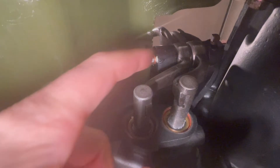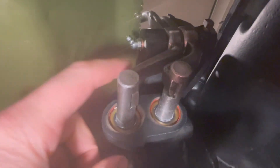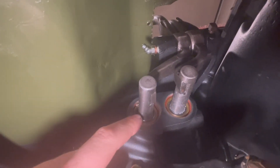This is how the shift levers should be oriented. The one with the longer neck goes to the pin that is further out, and the shorter neck goes to the pin closer to the bell housing. The shifter fits into a little slot and pulls the pin in and out to engage different gears in the transfer case, putting the Jeep into four-wheel drive, high and low.